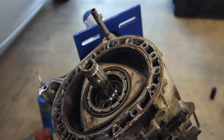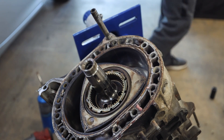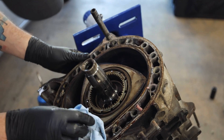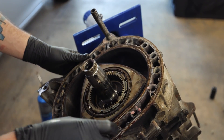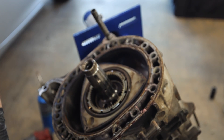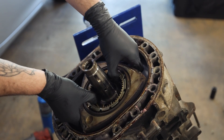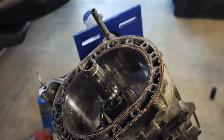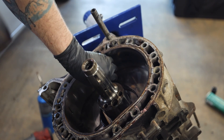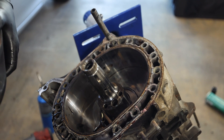Your apex seals are still good, bro! The coolant seals aren't because it's black - everything's just black. Side seals still look good. Apex seals are still there, so in theory - what is with all this bubblegum candy rock stuff? It's like bubblegummed out, like candy. Then again, it's been in there 10 years. Let's pull out Dorito number one! I can just grab it and there it comes. The bearing on the rotor - honestly, the rotors don't look too bad. I'm going to try to clean them up before I show you guys, but even inside, the housings don't look bad. They look old and dirty, but they don't look bad.